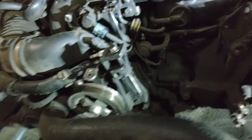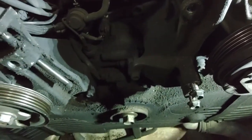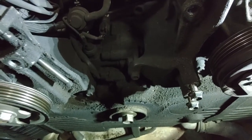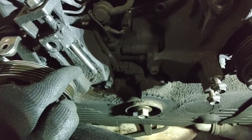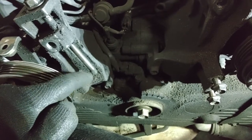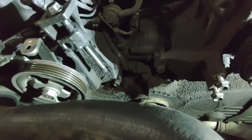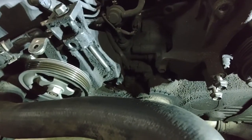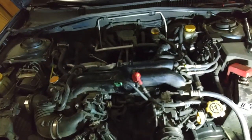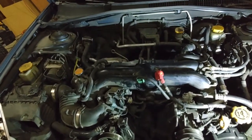One important note: if you have a lot of grime like I do, clean this area up thoroughly before you open the timing cover. This is debris you do not want getting into the timing area. Grime buildup in the grooves of the timing belt makes it easier for teeth to jump, and it accelerates degradation of the belt material. This is all broken-down rubber, oil, and road debris — so I'm going to do a good clean-through before opening the timing cover.